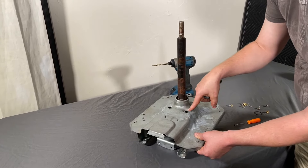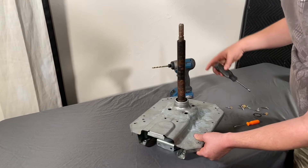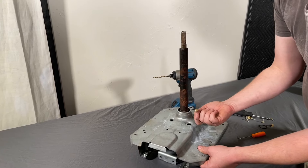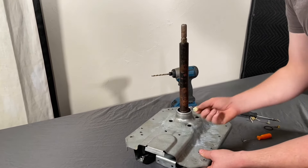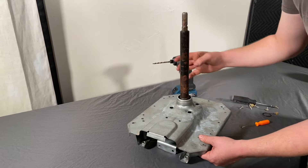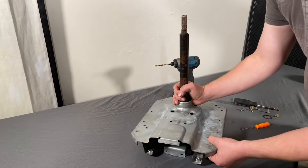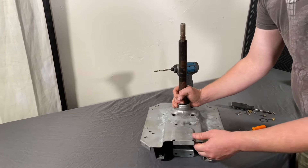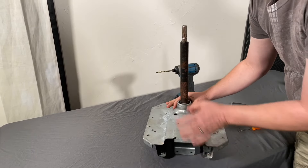There are eight screws in all on top of that transmission. These screws have sealing on all of them, so they're fairly snug. After you get them all the way out, you kind of have to push them with a screwdriver to get them out of place and make them fall out. But you'll notice that even with all eight screws out, it will still be stuck together.